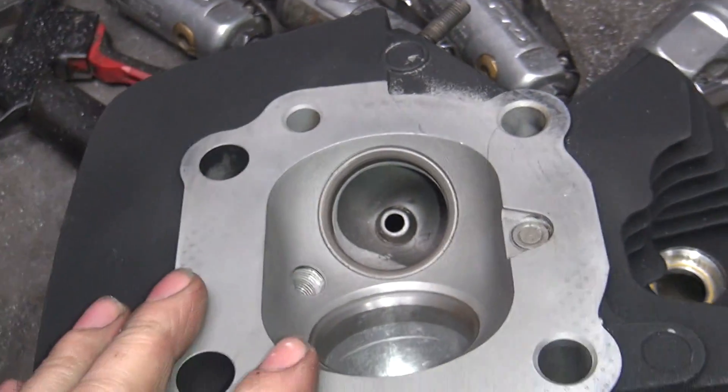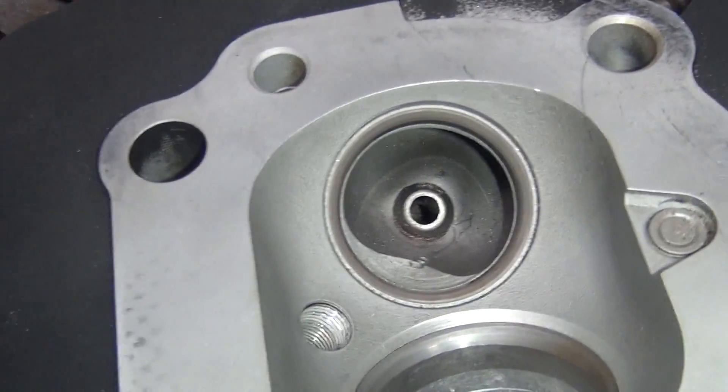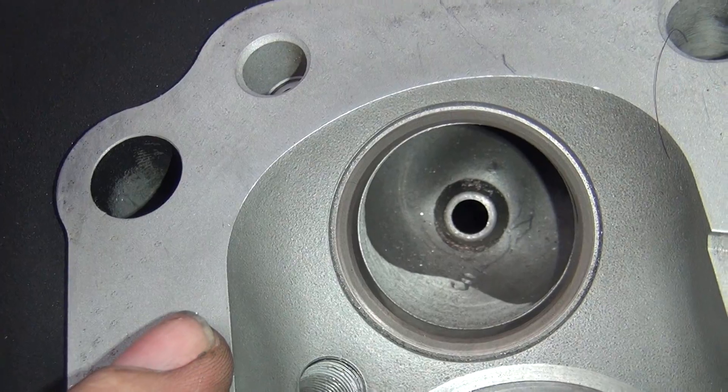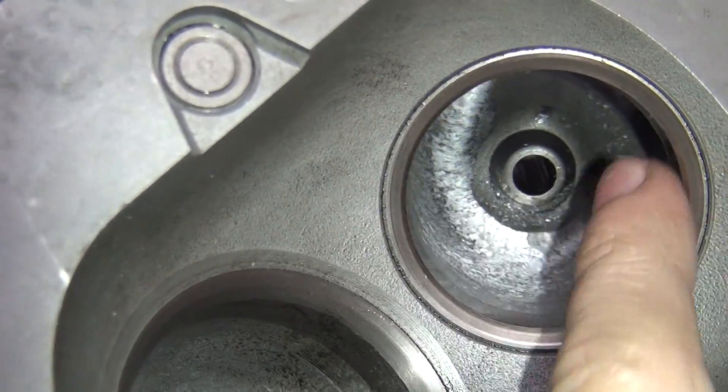We won't be showing quite as much as this one — it's pretty much the same as what I've done on the intake port. It's the same stuff you do on exhaust: just going to clean things up, straighten them out, knock off all the high spots. Get it so that you can go straight through the guide, pass the valve guide to a nice even radius, and then come back and smooth things up.